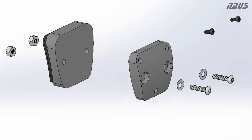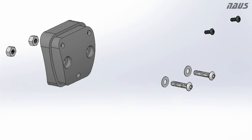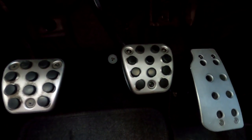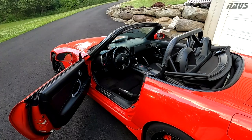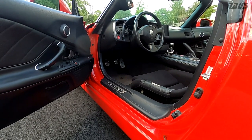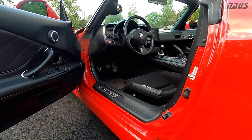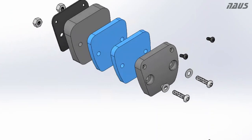This design utilizes two 10-32 bolts that go through both plastic spacer pieces and through the metal pedal assembly face itself, bracing everything together nice and strong. All you have to do is drill two holes in your OEM pedal and install the spacer. On top, instead of rivets, these are black stainless steel button head fasteners that look identical to the OEM rivets. If you find that this brake pedal spacer is not high enough, I will offer extra spacers with longer hardware to raise the brake pedal up higher in quarter inch increments.